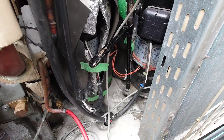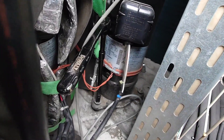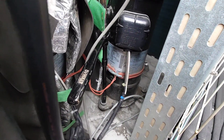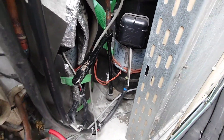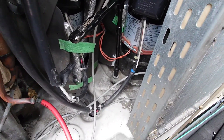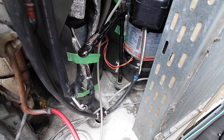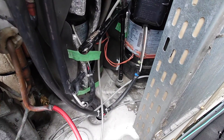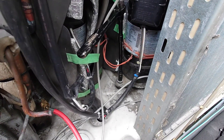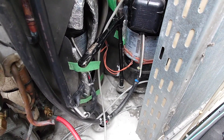Just a quick point to note: it's going to be tricky getting the bolts out from the compressor because there's only three. You can see two of them, but the third one is at the back of the compressor. To get to that I'd recommend using an extension bar on a 12mm socket — it looks like a 13 but it's not, it's a 12. Don't round these bolts off because you don't get new bolts with the compressor — you've got to use the old bolts and the old rubber mounts as well. So make sure you use a 12 as opposed to a 13 on your socket.